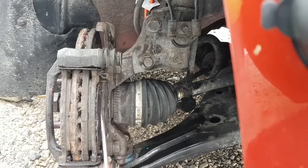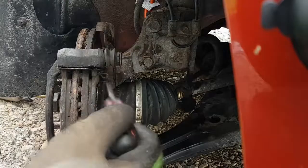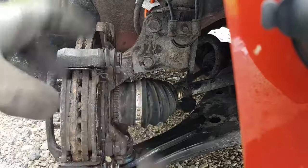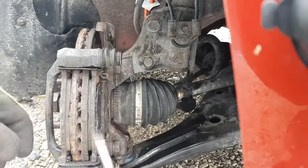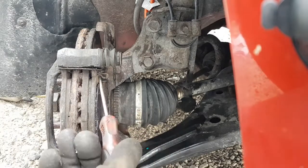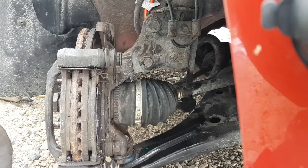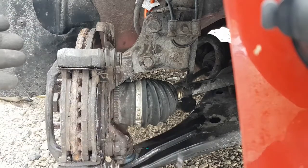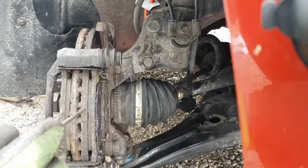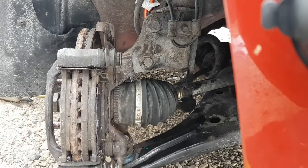The other side has a pad that's going to have this same squealer tang here, and it's on the top also. So look at the pads, because usually if you hold the pads so they're the same, the tab will be on the opposite side of the pad from the other, and then you know that one goes on each side. Some of the cheaper sets just have the squealers on the same side on both pads. So sometimes they'll be on the top on one side and on the bottom on the other side of the car. Some of them have them on both pads. Just pay attention to that when you take it apart. And what else can we tell you here too? Some of the cheaper pads, like I said, will have one on the bottom.